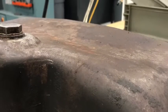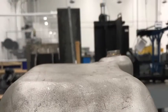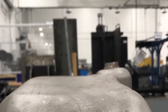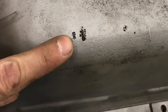The plug in the side of the block will need to be removed to help install the oil pump later. Once you have the pan clean, inspect it for pitting, scrapes, or dents anywhere. My pan had a bunch of dents and scrapes that I had to take a press to and press out. It actually had some pitting in the bottom because of all the dirt and sludge — there was actually a hole that had to be repaired.